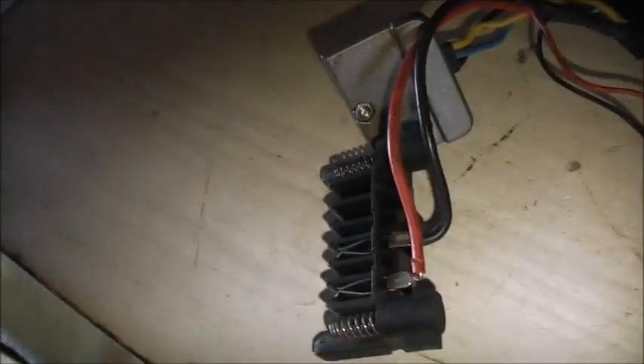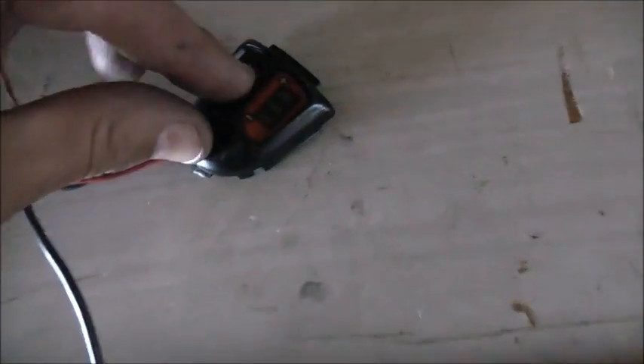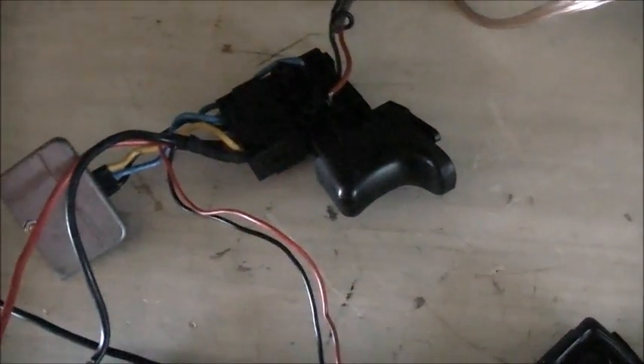Let's put it back together and give it a test. I pulled out the melted contacts and managed to get them apart. After reconnecting and plugging it in, it reads about 15 volts rectified - it's made for an 18 volt battery so it shows about three quarters. But then it popped the breaker - the contact in there is too far gone, just shorting when brought together.